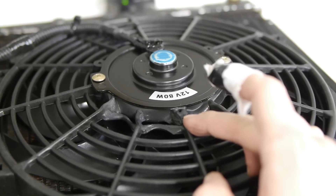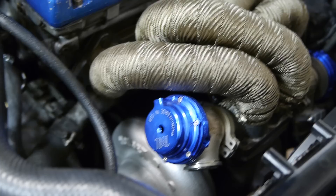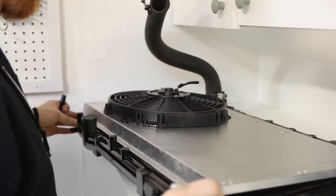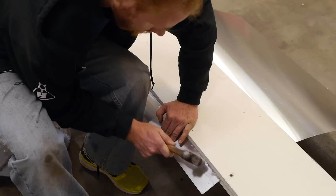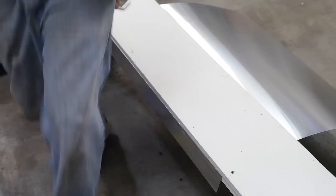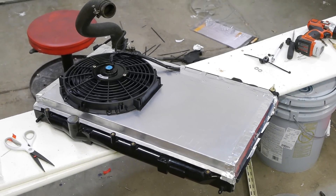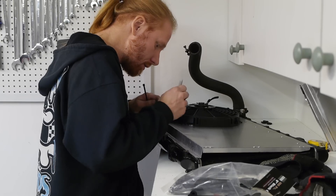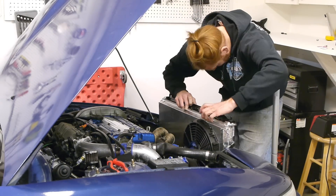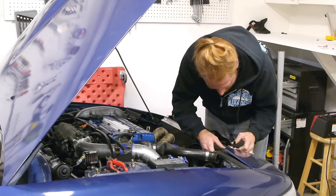I think there are two problems: we're way too close to the turbo housing, and I suspect there's an exhaust leak from the Chinese wastegate. Either way, I won't be able to run two puller fans in there. So I decided to try a fan shroud — I made a custom shroud from scratch and it worked amazingly well in stop-and-go traffic. On the highway, however, it failed to keep the car cool as it didn't allow enough flow. I could have added flapper doors, but after confirming exhaust leaks from the Chinese wastegates, I decided to go with real Tials and then back to two fans. If you want to see a full video on making a fan shroud, let me know in the comments.